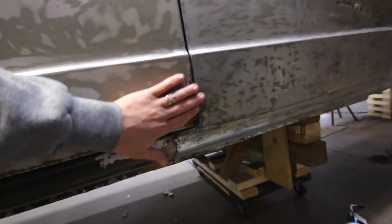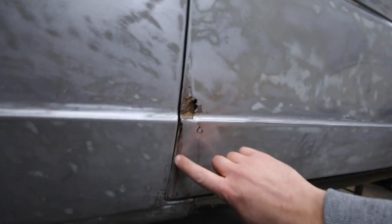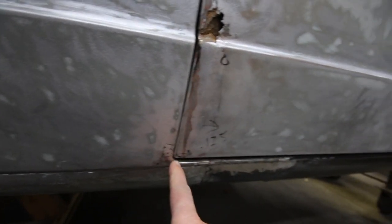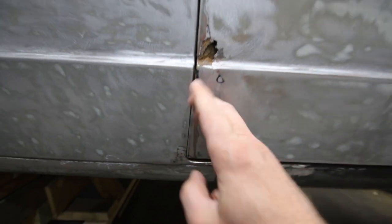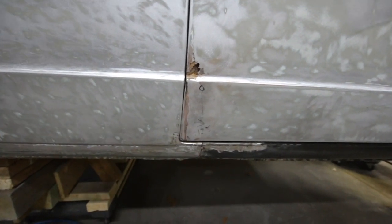You can't open the doors yet. This side has a little bit of rust, and there are little spots along the bottom I need to address. On the passenger side there's a rust hole, and that door must have been worked on before because there's a mismatch and the angle of the door is different. The gap is good all the way up the side except it gets tight right here. So when I fix this, I'm going to try to tweak it over to adjust the gap — that'll be a little tricky.